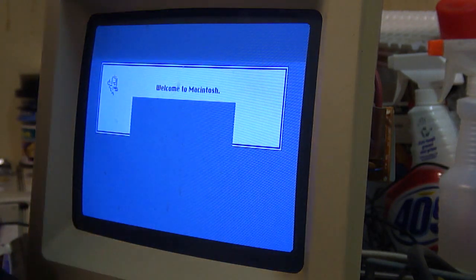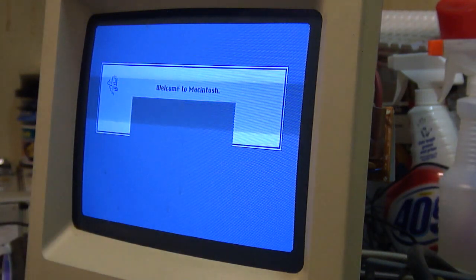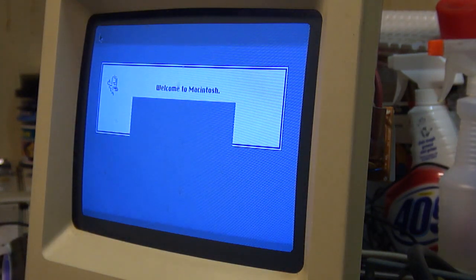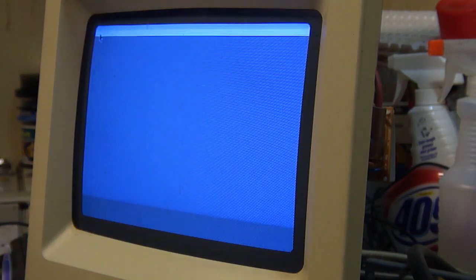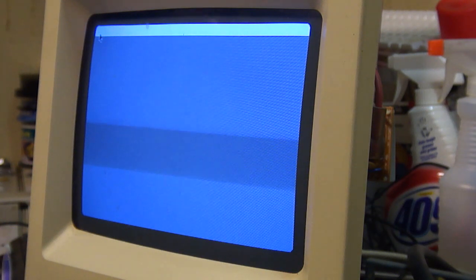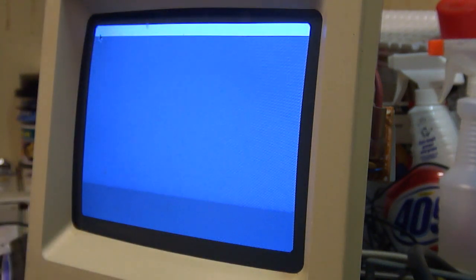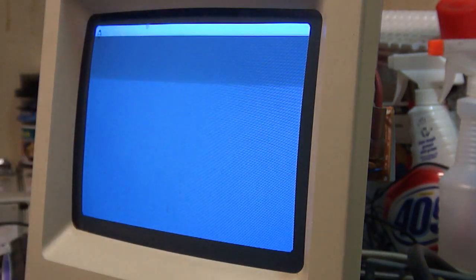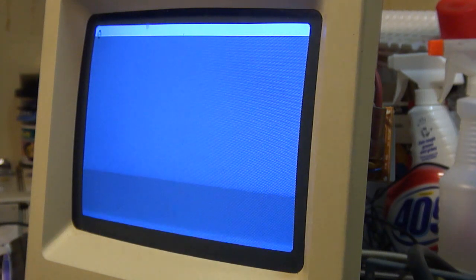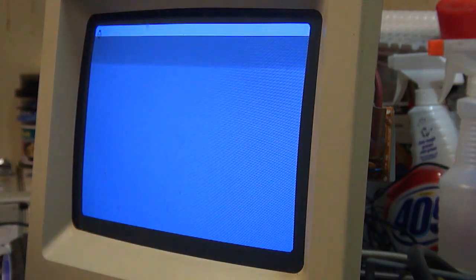So I'm thinking, since this drive has sat for so many years and it's full of dust, I don't have a cleaning kit to stick in there real quick, so I'd have to disassemble the entire drive without losing the alignment to clean that drive, so I don't lose the head alignment. Just like cassette tapes, the heads get ferrous oxide or whatever else on the material build up on the heads, and then plus that needs cleaned off, and then the heads need demagnetized like a tape drive or a VCR or something like that. So it's all vulnerable to the same problems and the same maintenance.